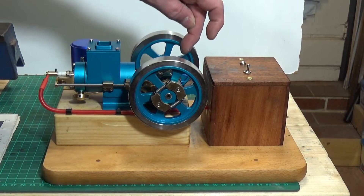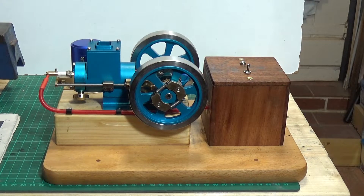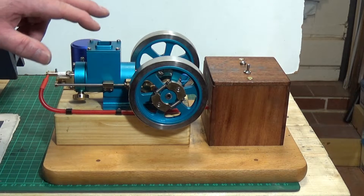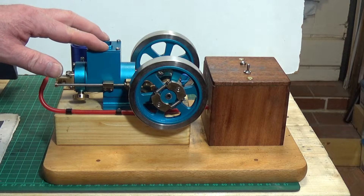Don't forget to add the extra ground wire which goes from the engine mount through to the ignition box. And also, anodizing is not conductive — so you put a meter on any part of this engine which is anodized and you will get open circuit.